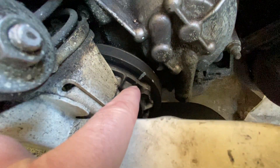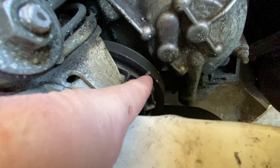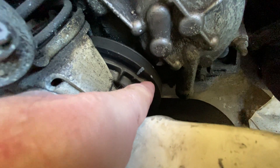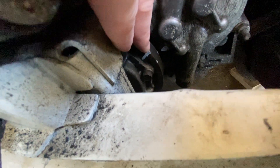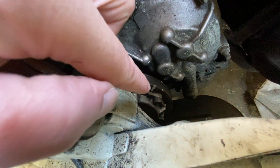I marked my points on the pulley here. This is the mark on the pulley, and I have to be 13 millimeters off, which means 10 degrees before top dead center. This dot I made here corresponds to the arrow on the body of the engine. In order to get a spark there, the two points have to open exactly at that moment.